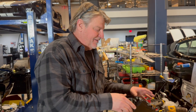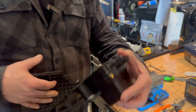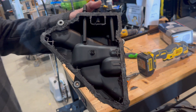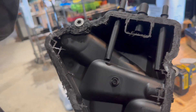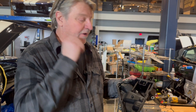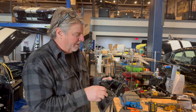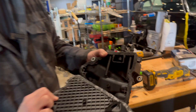What do you think is going to be inside? You think it's going to be a maze? A check valve? Something holding it all together? Pretty much nothing. These are the two ports that come in from your crankcase, from the top of your valve covers. This goes to a vacuum port — but not the traditional one you'd be thinking of. This goes all the way up to the airbox in a Corvette, Camaro, or Denali, whatever you've got going with the LS or LT4. It just keeps oil from getting in, as it drains out the bottom back down to the oil pan. It's a pretty simple device.